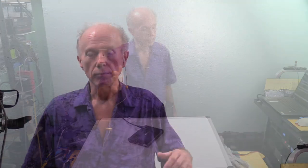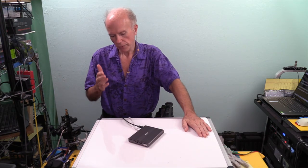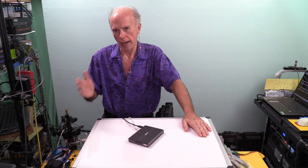About how many drives will it support: four drives. You can have as few as one but you get the speed of one lane. In RAID: one drive, one lane; two drives, two lanes; three drives, three lanes; in JBOD it's one-to-one. Can the RAID be moved from one computer to another? You could, but it would need to be exactly the same — apples to apples. A Windows machine to a Windows machine. Could you move this RAID to Linux or Mac? You'd have to try and find out — I think it might be possible but I wouldn't bet on it.